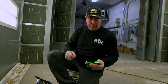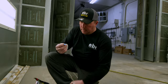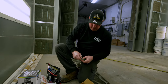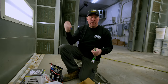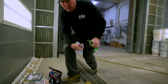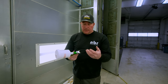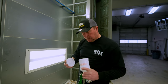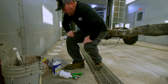This is my brand new Harbor Freight paint gun. I'm putting a handle on it and going to put a little pipe tape on there and get this thing set up so we can go to painting. I do have a regulator on the other side so the pressure will be regulated. I've got to run some mineral spirits through this first — brand new gun, it's probably got oil in it. Just clean it out real quick before we go to painting and get an idea of how it's going to spray. Rustoleum says to mix their product with mineral spirits, so that's what we're going to do.